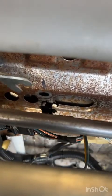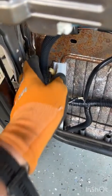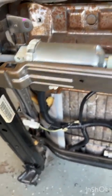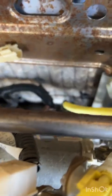All right, just use the Christmas tree puller to pop this guy out. Now I got this guy over here, which I'm probably also not going to be able to film because it's kind of a two-handed job, but maybe I got it. Hey, all right, look at that. So I believe now the seat cushion is free, except there is a clip holding it to the bottom of the wire on the seat bottom itself.